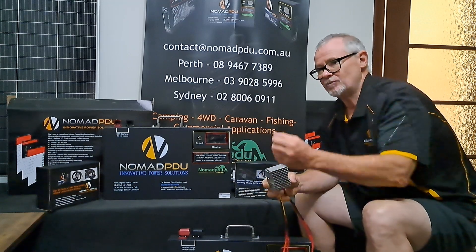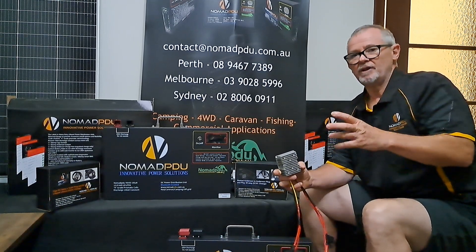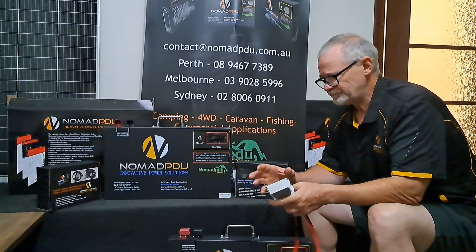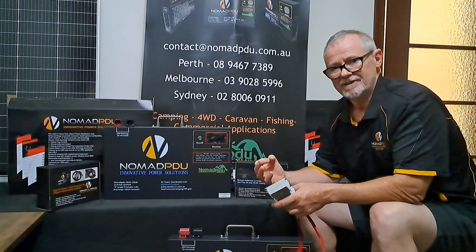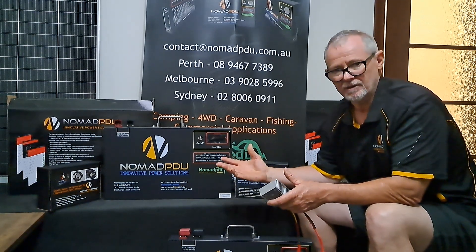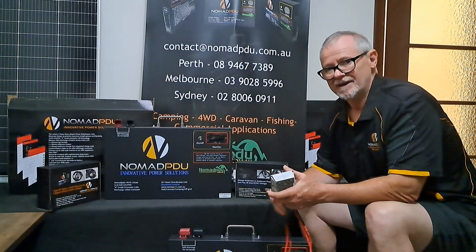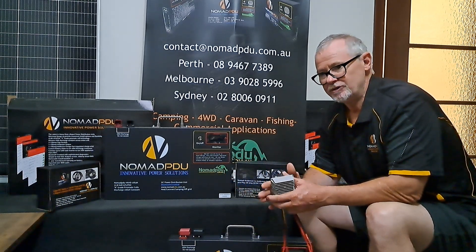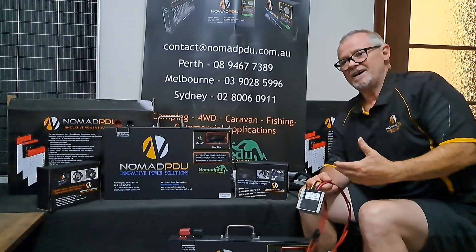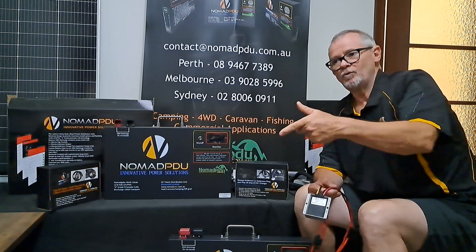DC is direct current — your lower voltage stuff — and AC is 240 volts. This tutorial is for people who want to understand DC-DC without overcomplicating things. For dual battery setups, make sure if you're getting someone else to install it, get them to show you where the cable run is. We often see vehicles come in where people have cut into existing wiring or used a dirty earth. What we like to say is: run a clean run from the crank to the VSR, and draw a simple mud map of how it was done.